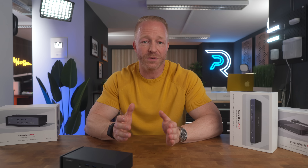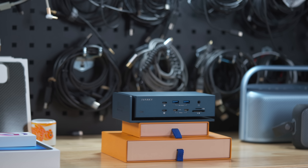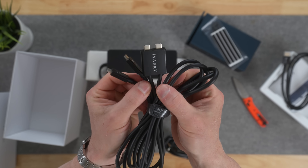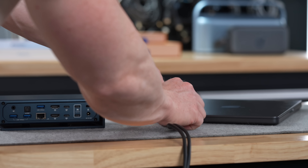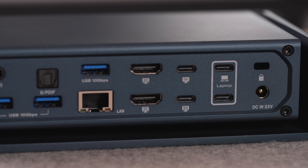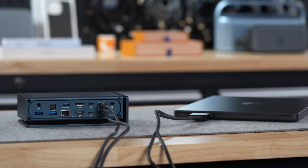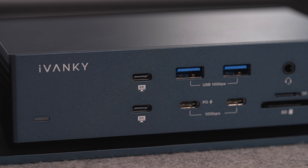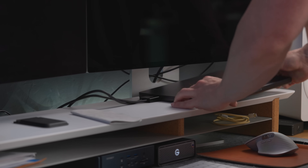The first question that popped into my head when I saw all these ports is how on earth is this thing powering all of this I/O. The 40 gigabits per second dual USB-C cable literally means there are two cables on each end. This thick-looking part is engineered so that it perfectly fits the two Thunderbolt ports on the left side of the MacBook Pro. Built into the Fusion Dock are two Thunderbolt 4 chips, so when you hook the other sides of the dual USB-C cable up to the dedicated ports on the back, that opens up all the features of the other ports. So even though we are technically using two cables, it is still a single-cable-setup type of deal because of the way it's designed. Very clever.